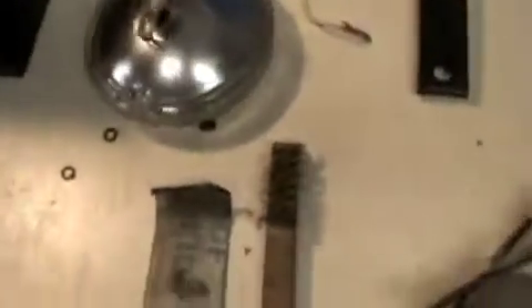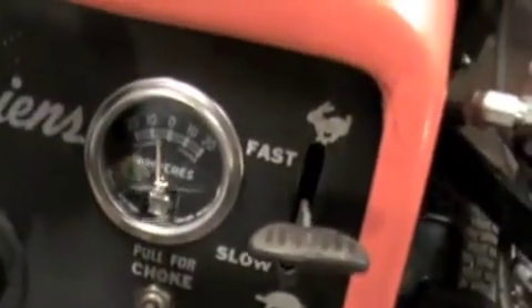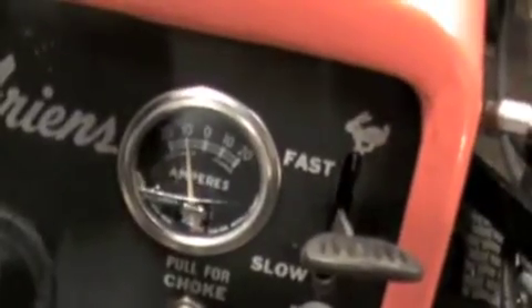Within the next week off I have from school I'm going to see if I can't find the original lights for the front, because the number on those ones are different — those were out of a Wheel Horse. The number here is 271 and the other one is 276. I think the amps are a little too high because before these ones burned out they were a little more dim, and I think these ones are drawing a little bit too much power. As you can see, when I turn on the lights and the clutch at the same time it draws quite a bit. But it's got a 15-amp stator in this engine, so it should have plenty of juice to feed back and keep the battery from drawing too much.